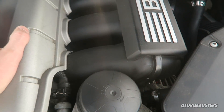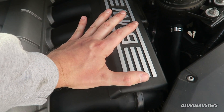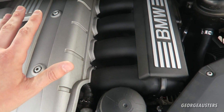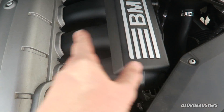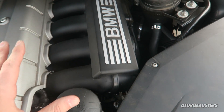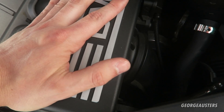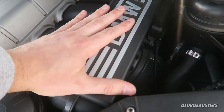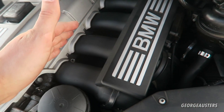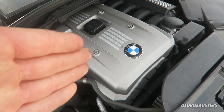Another part to fail after 100,000 miles is the crankcase ventilation system, which is linked to the intake manifold — you have to remove the intake manifold to access it. The crankcase ventilation system takes hot crankcase vapors away from the engine and puts them back through the intake manifold to be burned off again, which is good for the environment but the system often gets blocked up after 100,000 miles. Because it's a fairly big job requiring intake manifold removal, I would pair it with another job like replacing the starter motor or the DISA valves.